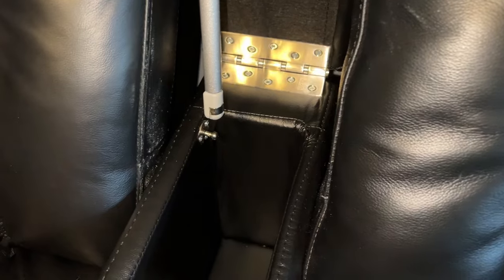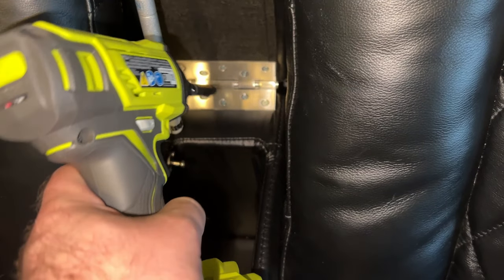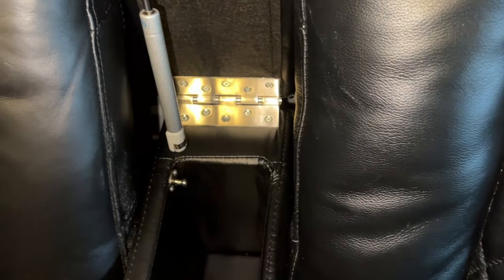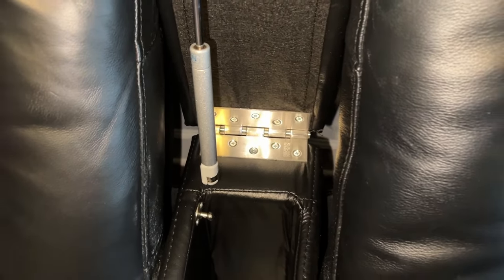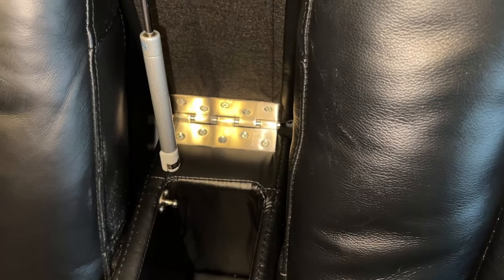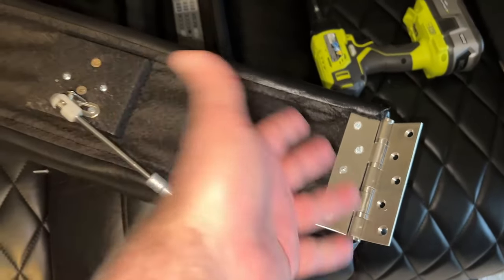You can take the strut off either side. I'm just leaving it all with the actual armrest because I don't need it hanging down in there. Got this up and out of the way, now I can zip out these five bottom screws. Note we're going to be putting this bracket back on, and you need to be very careful because the wood is just MDF — you don't want to put any torque on these wood screws. You'll notice it's crooked and all my brackets and armrests are crooked and all different because whoever assembles these is doing it by eye. I also had mixed and matched screws — a couple machine screws where there should have been wood screws — so just pay attention to that. Do not over-tighten these when putting them back in.